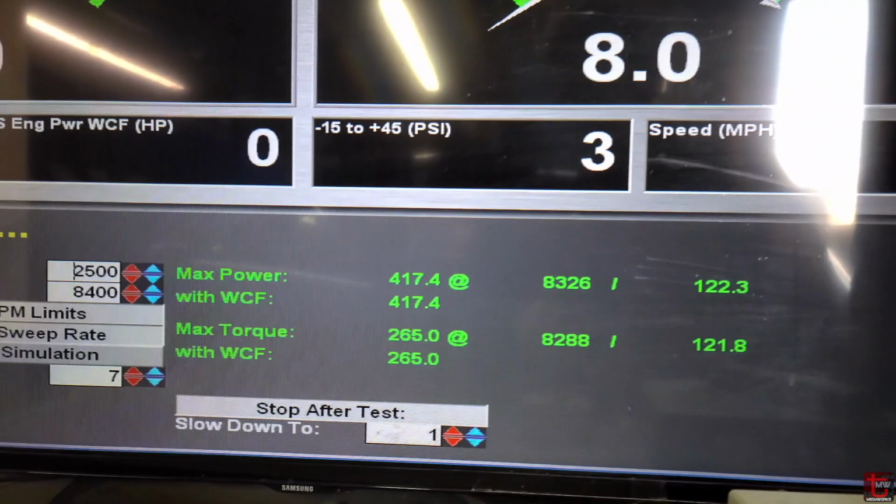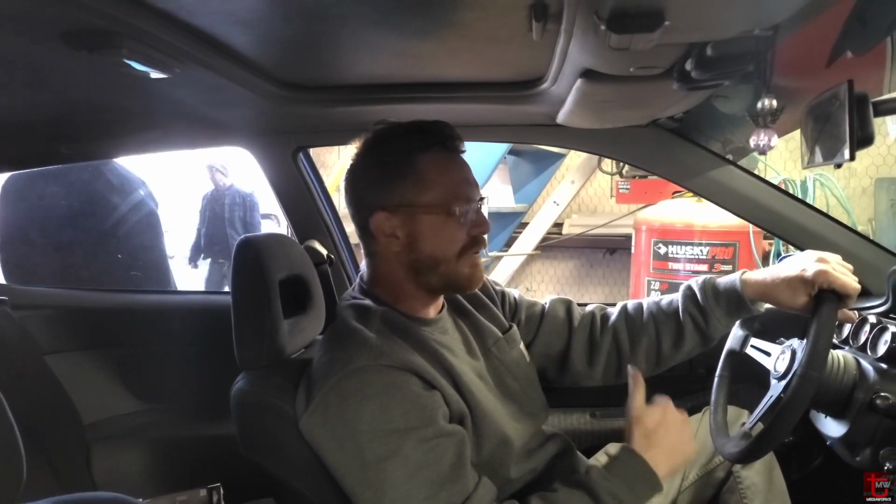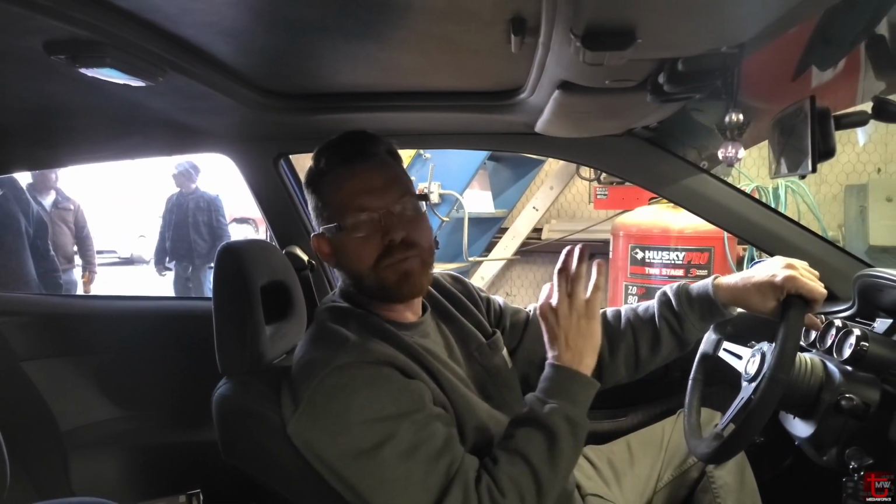Hey, there we go. I got you. Just need 3 more, bro. We're still a little bit rich. There was still some 10-0 in that run right there. So I'm going to take away another like 2% fuel, and then we should be at our money.